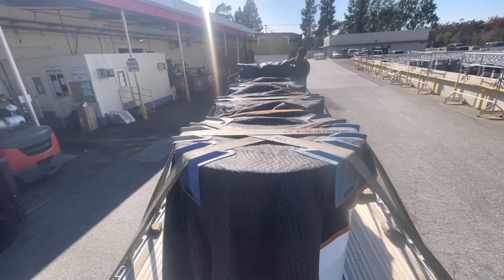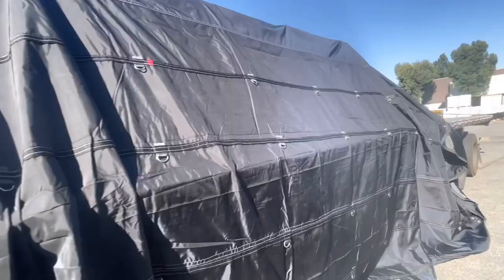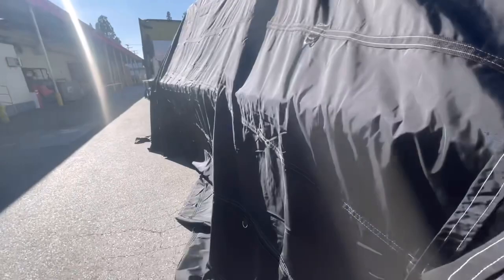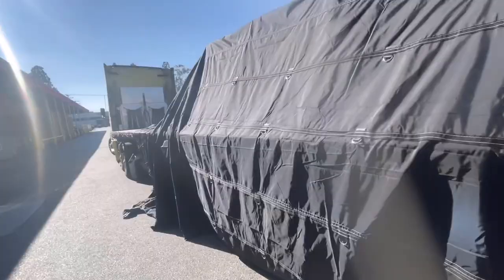Now we're going to go ahead and lay our tarps, get bungeed up, and we'll show you what this new tarp looks like spread out over these coils. Here she is — got the new airbag tarps out. I did go with eight foot drops. I would rather mess with a lightweight eight foot drop tarp any day of the week versus a six foot extension. So what we're going to do here is pull our flaps back like a tail, pin our four corners down, then take a look at it and see where we can start tucking and running this fabric.